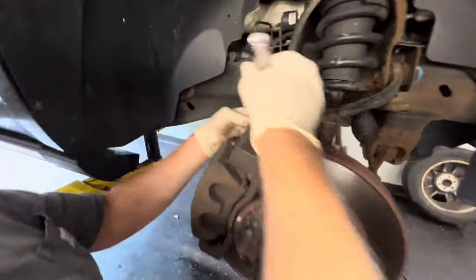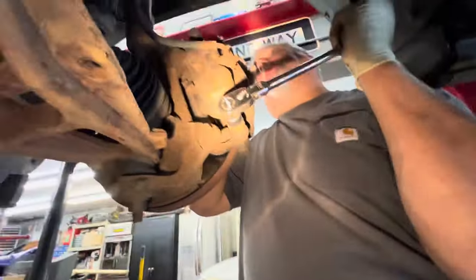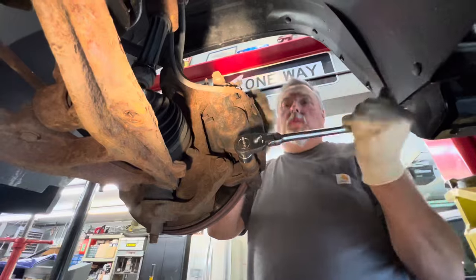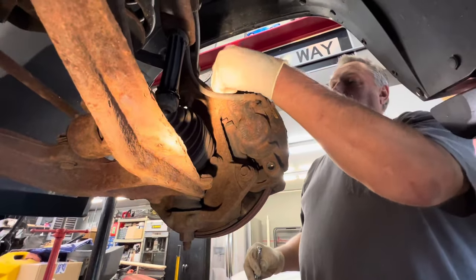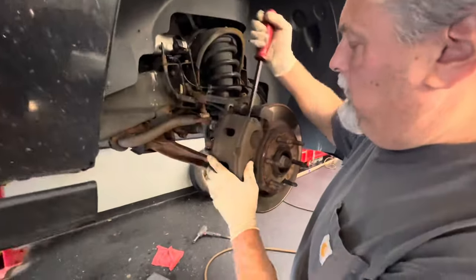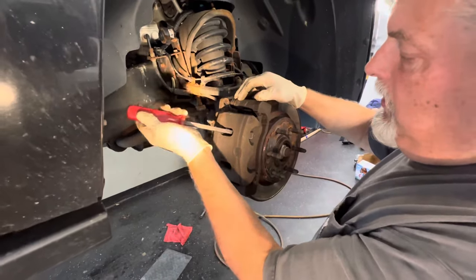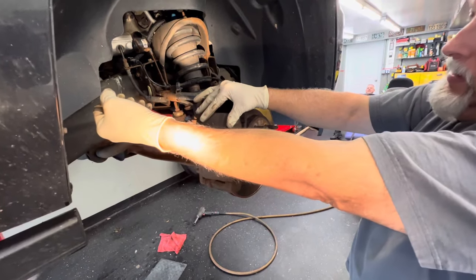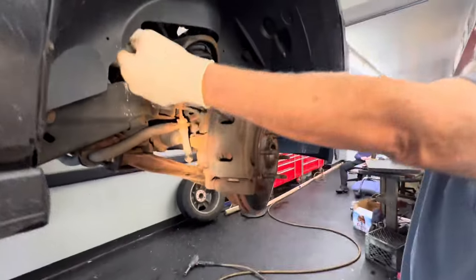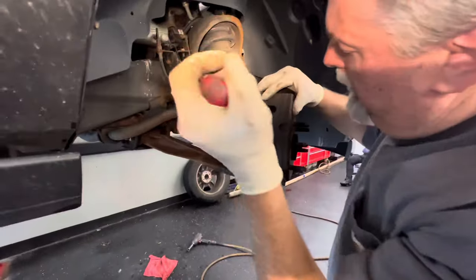There's no pulsation with the brakes at all, so I'm going to change these two over. I'm going to lubricate all of our caliper pins. Got a couple of different ways of collapsing the pistons on this. You can pry and collapse the piston somewhat, or you can use your vice grips to collapse it, or use a piston collapsing tool to try and get in here.